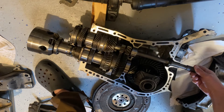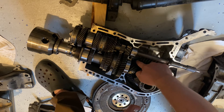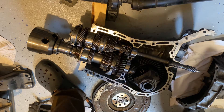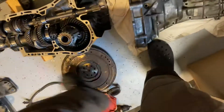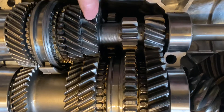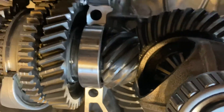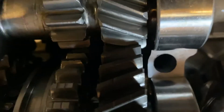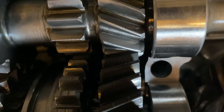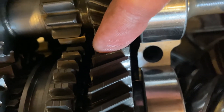Your final drive is set on the ratio between your pinion and ring gear. One thing that's really cool about this gear system is that some gears are straight cut — for example, the reverse gear is straight cut — and some are helical, and then there's the hypoid. With helical gears, as I spin it, the contact pattern begins on one shoulder and then moves across the face of the gear and leaves on the other shoulder.